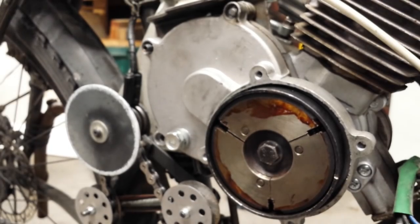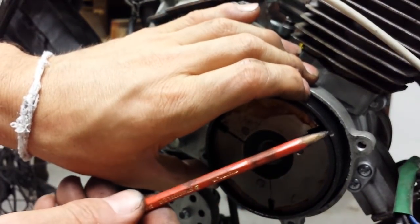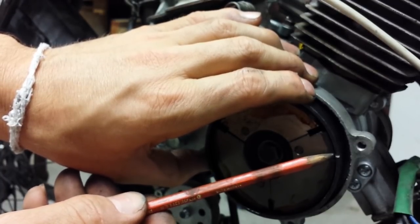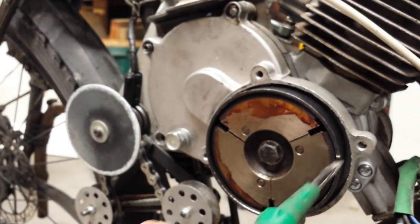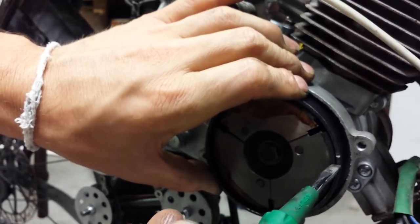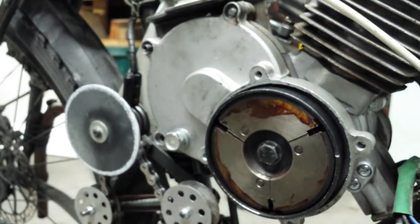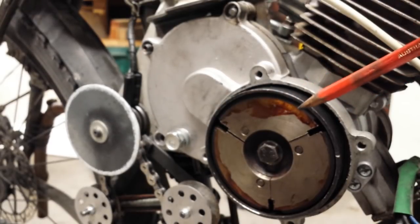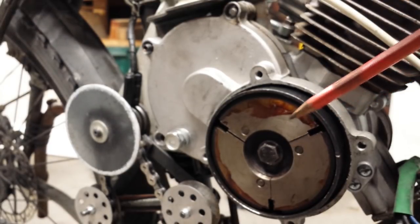To achieve this, you need to drill a hole in the extension housing cover — in this case, a six-millimetre hole in the cover. This six-millimetre hole sits in position on the housing. You simply put a screwdriver through the hole, rotate the wheel of the bicycle backwards, and as the wheel rotates backwards the clutch bell is also rotating. You will feel it get to a certain position — and bang — the screwdriver drops into the little indentation in the clutch bell. You now know the clutch bell, the gear attached to it, the hole in the gear, and the hole in the paper gaskets are all lined up.